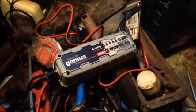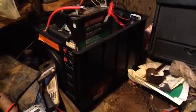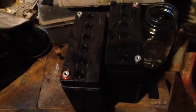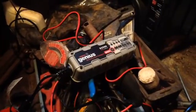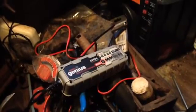Here's the final part to my review of the NOCO Genius G3500. I'll start with the disappointment. I was trying to charge these 20-amp-hour sealed lead-acid batteries, which came out of another project — an illuminated power pack generator, basically a battery-powered 60-amp-hour inverter combination. In that were three separate sealed lead-acid batteries. I tried to charge them with my NOCO Genius, and it didn't work. It went up to 100%, suggesting the batteries were full, but when you took it off, it would shoot back down to around 10 volts.